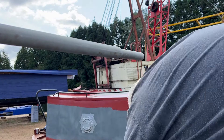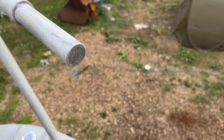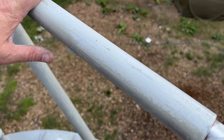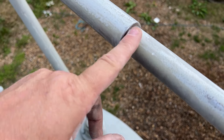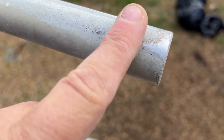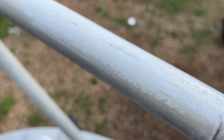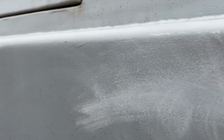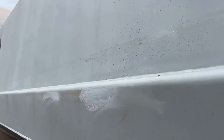That's come up well. I'll get some primer on it — just a wee bit there. I've been trying 240 grit to flatten it and I'm going to try 320. It's quite easy to take that back to steel, and that's what the recommendation was — take it back to steel and then put the two-pack on it. So the touch-ups are done. That bit was gouged out. I haven't done the hinges yet — I'll do them when I take the doors off. Now I'm just going to clean them up with some degreaser and a lint-free cloth.